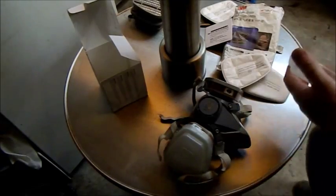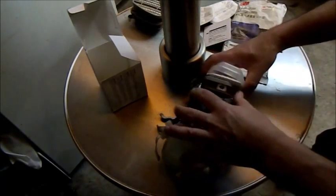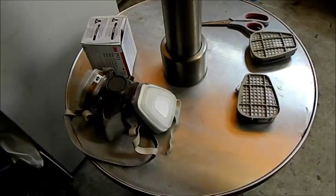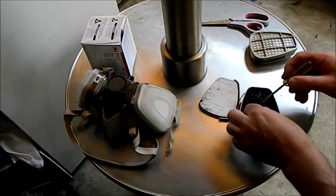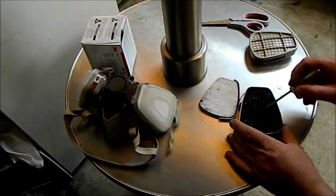Whenever you're painting it's always important to seek the advice of a qualified painter. I'm using acrylic products — they're very DIY friendly. I'm not interested in using 2-pack. There are isocyanate-free 2-pack paint products which are supposed to be safe to use, but they're very strong in their vapors. Inside these cartridges you can see it's got a fabric filter and it's all full of activated charcoal particles, and these do have a very defined life.